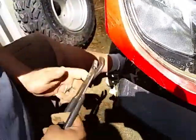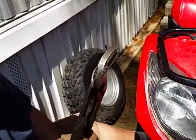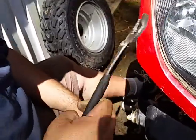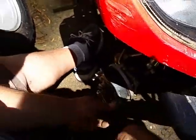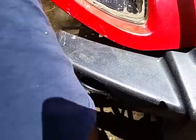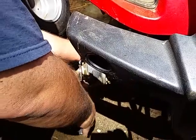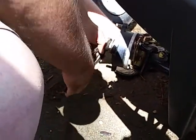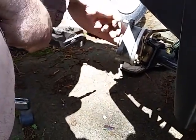We're going to take this wrench. Now this is not a proper wrench. Use a box wrench or a socket. A socket would be great. If you don't have a socket, this is what you're going to use. Try not to let this slip. You're just making this a little bit tight. See, that's too tight. Hear that? That's too tight. So I'm going to back this out a little bit until it's right there, as long as it doesn't move. You don't have any in and out movement.